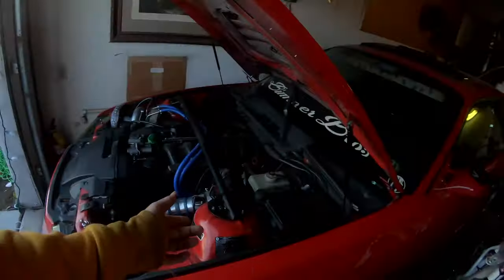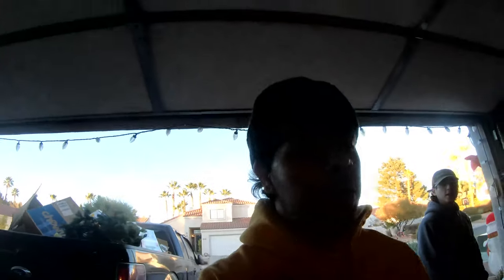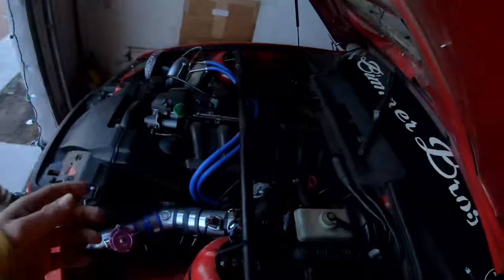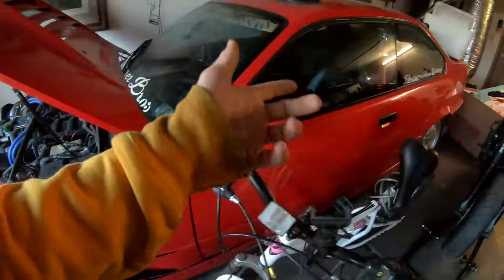A lot of boosted E36s and pretty much a lot of boosted cars that go from NA to turbo have this problem as well. I shouldn't have this problem, but I got to talk to my tuner. My only problem is my tuner - I have to get a remap and a retune so I can get more fuel to my car. Right now I have fuel cut. I'm trying to boost it and over boost it. I had a 15 pound spring giving it 20 PSI, so I put it down to 10, so now I should be doing like 15 PSI, and I have a fuel cut. I also have a fuel cut when it's under a half a tank.